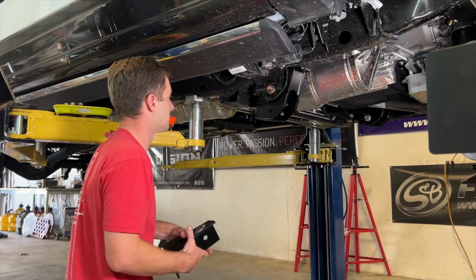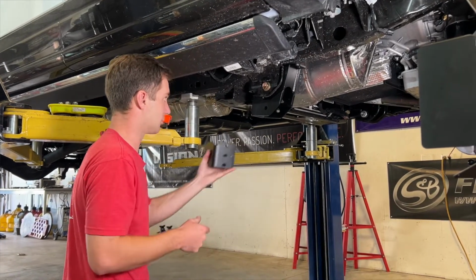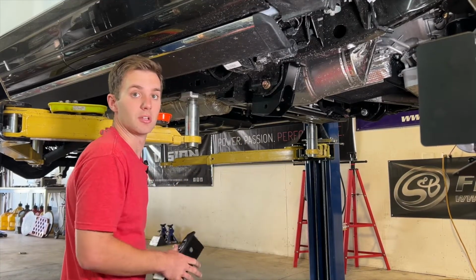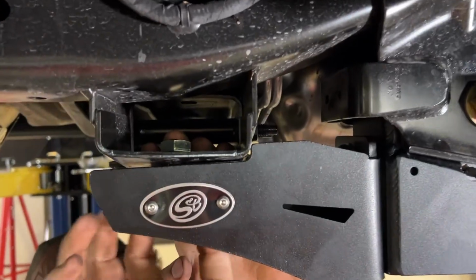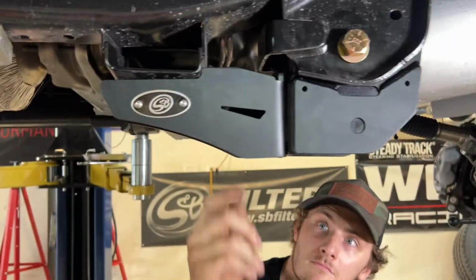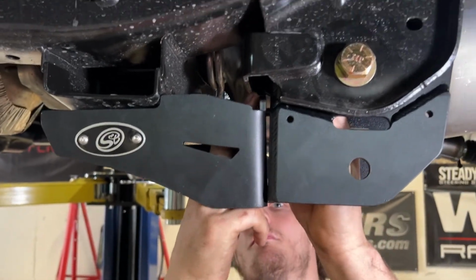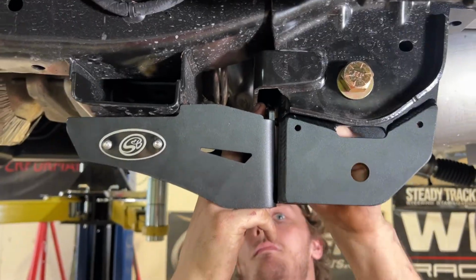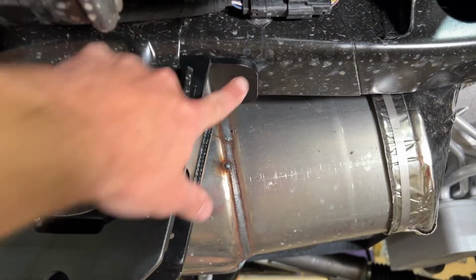There can be some variations in the shape of this tab, how the frames are welded, so we wanted to make sure these are 2 pieces so you can get everything installed easily. So we drop the bolt in, top down here since you can see the bolt head, and we have everything hand tight now. Got 2 of our bolts started between the 2 here, so we're going to start snugging everything up and lock this whole thing together before we move to drill our additional hole here.